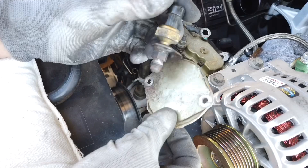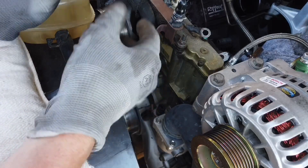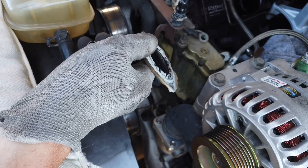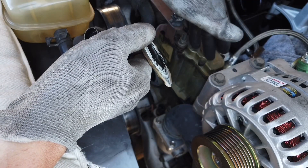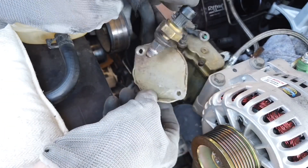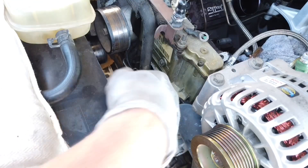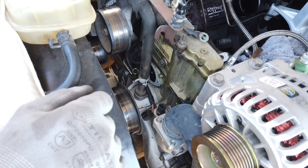Here's the cap — you don't need to remove the sensor, just these two bolts. I didn't drain the reservoir beforehand because it actually drained on its own when I disconnected the line from the head. I didn't think about it, and the next day the whole floor was covered in oil. This is the gray silicone that needs to be cleaned up and replaced. The cap has the sensor on it; I just had to disconnect the metal tube going down. Inside there's a big bolt — I believe it's a 19mm — that I need to remove to pull the pump.